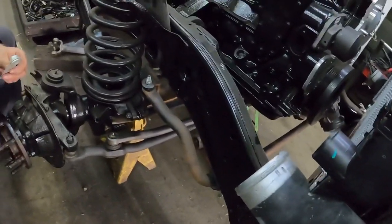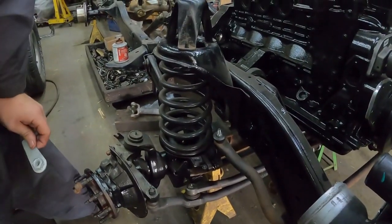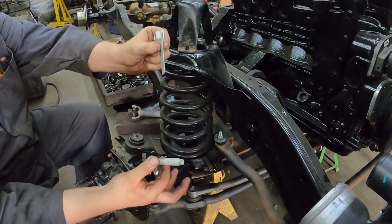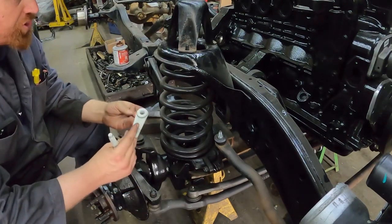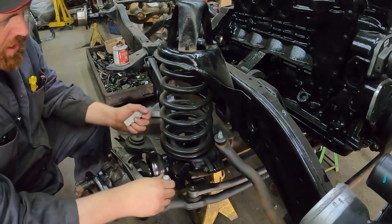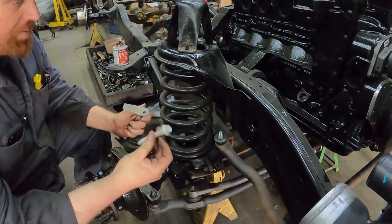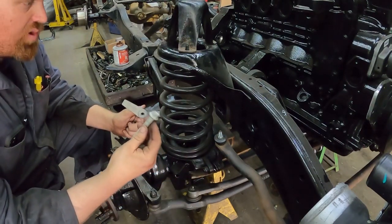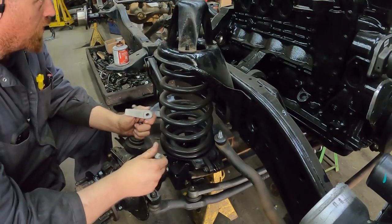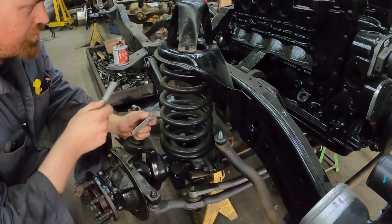If these are broke, they're not that expensive to buy new. I just bought all this stuff — I recommend replacing the bolt and the nut tab personally. So this is 18 mil if you're pulling it off. Usually what you'll have to do is get your steering in just the right spot. This is going to be 18, sometimes 21, depending on the year of the truck. This setup will work for 94 to 2012 — anything non-radius arm. If it's a radius arm truck, they're different.